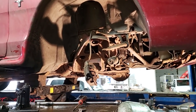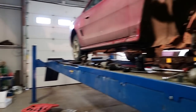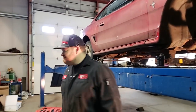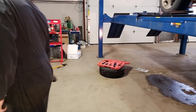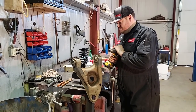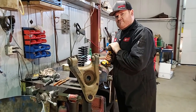Sean has the entire front control arm out. It wasn't too bad of a job, but where we're replacing everything with new ball joints and new tie rods, we're able to pickle fork everything apart. You can't pickle fork anything you intend to reuse — important point. Also, never hang your calipers by the hoses; always hang them up with a coat hanger or something. Do as we say, not as we do. We've just pushed the ball joint out — we had all the proper pullers, a fantastic but super expensive kit. Most home gamers won't have that, and it pushed out the bottom but then we had to extract the shell because they're original. Our recommendation: if the car's old and it's got some mileage or you're uncertain, buy replacement control arms and start from there — way better, especially for the home gamer.